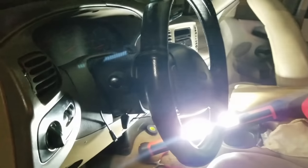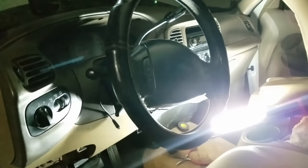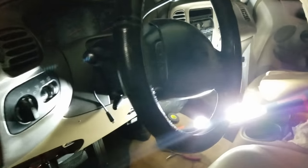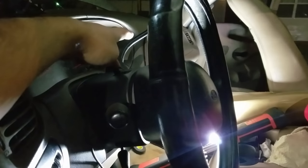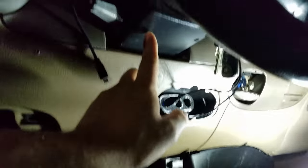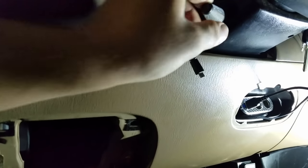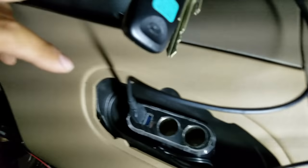You're going to need to remove your ignition lock cylinder. There are a lot of reasons you may want or need to replace it or pull it out. For example, your turn signal windshield wiper multi-function switch, which also houses your flashers — this switch will require removal of the lower steering wheel bezel, and you're going to need to remove your ignition lock cylinder in its entirety in order to get this lower plastic cover off.